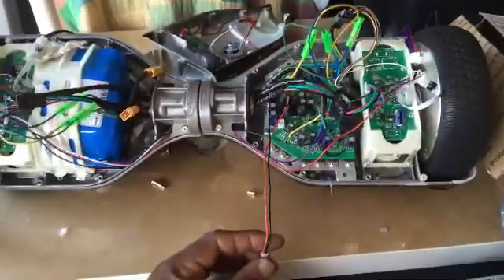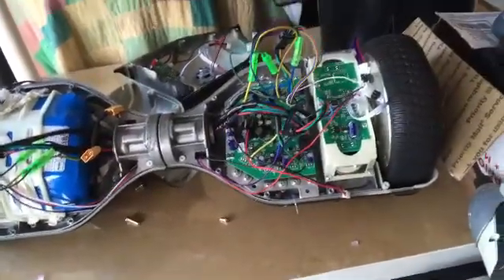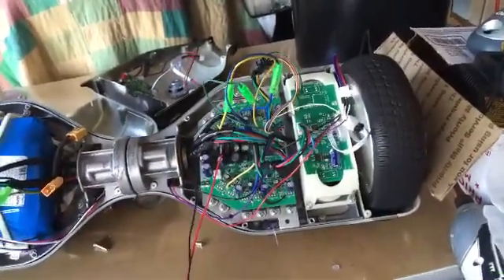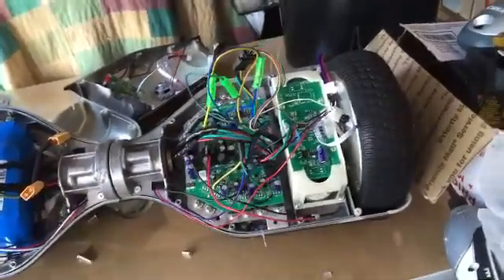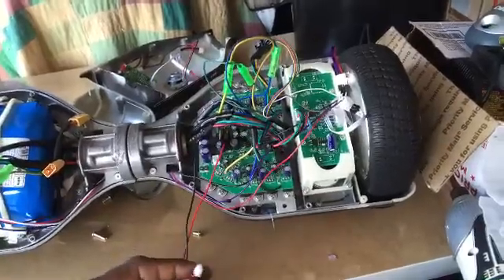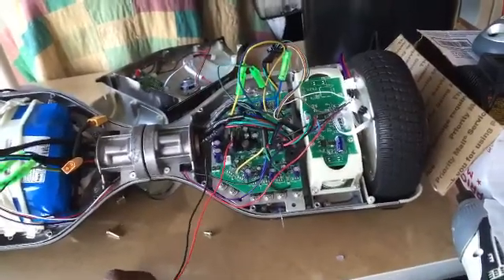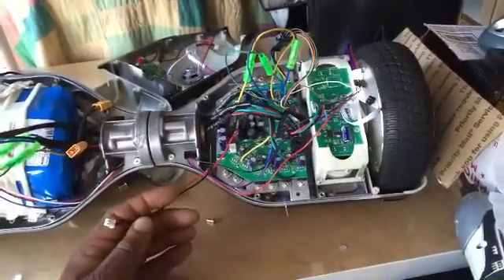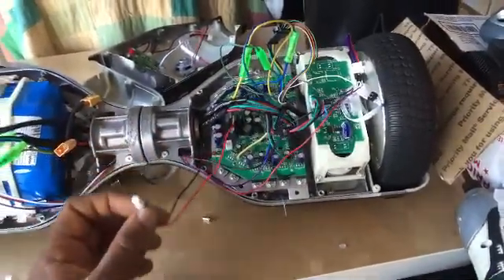Here is the Bluetooth. Some hoverboards come with Bluetooth capabilities, some would not. When replacing your motherboard, you have to make sure that you have a motherboard that has the Bluetooth capability wires built in. This particular motherboard has a Bluetooth connector simply because it was replacing a motherboard that had Bluetooth. If you get a logic board without this Bluetooth connector, it will still work, but you will not be able to use the Bluetooth. So when ordering your logic board, make sure you order one with the Bluetooth connector if your hoverboard has a Bluetooth motherboard.